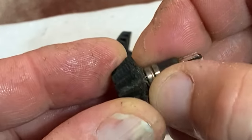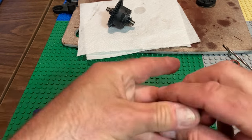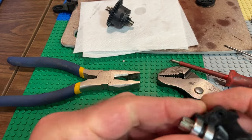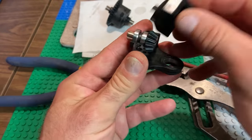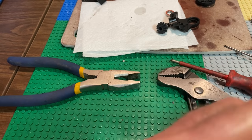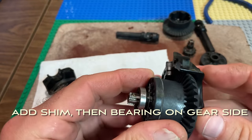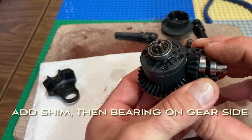This is that battered input gear — I ruined the bearing on it. I now have a new gear and two new bearings. I used one top bearing from the old setup as my spare. You need to press that bearing on — using a socket would be a nice way to do it. I'm dry fitting the yoke to make sure there's no binding. When it comes time to install it onto the differential, the tab goes on the left side, no tab on the right side. It's handy to start on the gear side so you can lay the input gear and both bearings in — they need to seat firmly in the yoke cover.